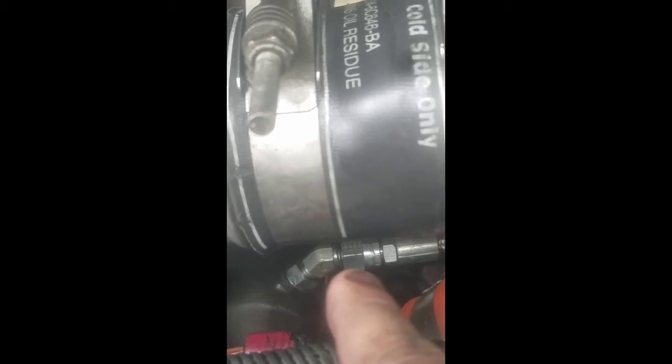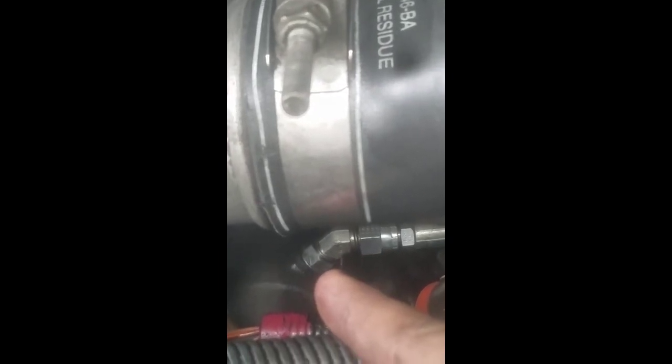When you get it, I don't know if yours will come with instructions - mine did not, I had to Google it. You're gonna have two separate pieces: you're gonna have this piece on the front right here, and then you're gonna have a connecting piece that's gonna be the hose. You're gonna want to screw this first 45-degree angle bit in as far as you can to the angle where you want it to line up with your hose to go to the other side. Once you're at an angle that you like, go down and tighten this bottom bolt.